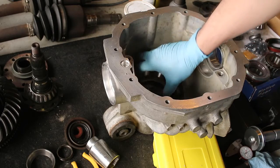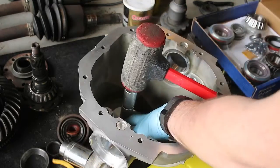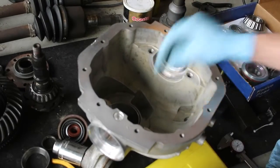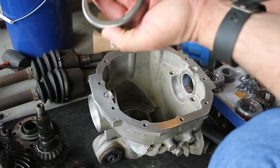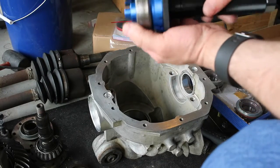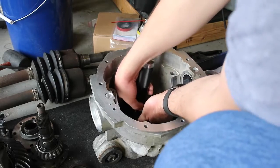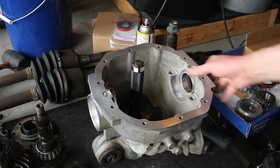These are really nice bearings. Alright, sits perfect. Alright. It is below that lip. Alright, it's not elegant, but it's a solution. Here's the race that came out of the case. Here's that adjustable driver. Got it set so that it sets up on that shoulder. I'm going to put the lips of the shoulder onto that shoulder. And there's almost no wiggle room, so I should have some very good strikes here.